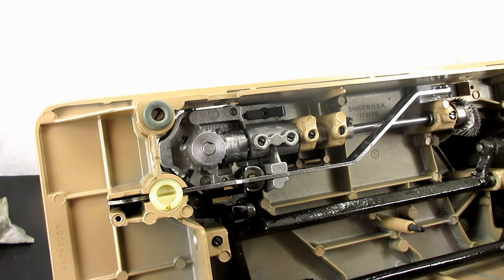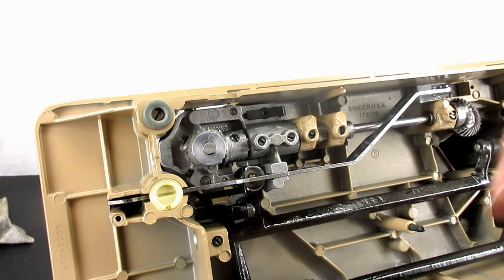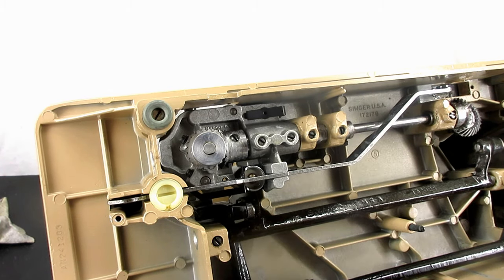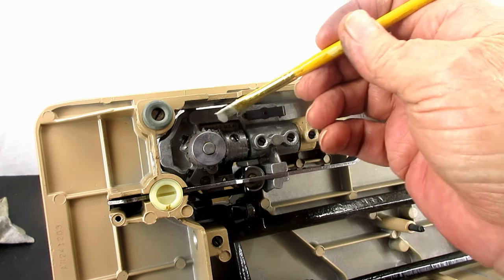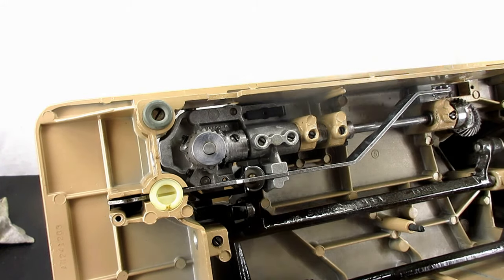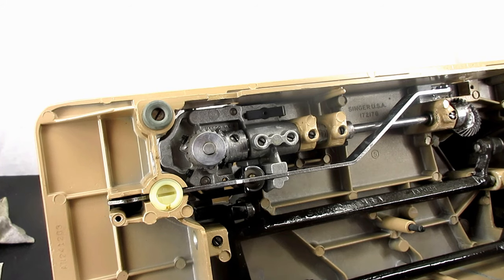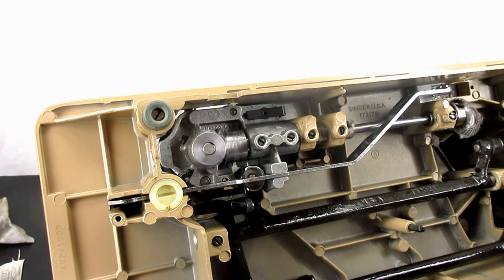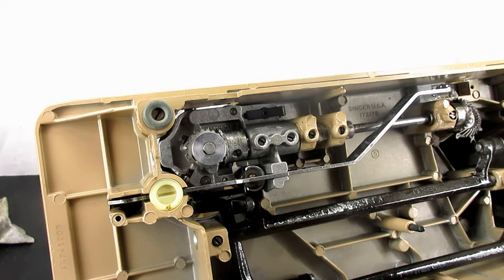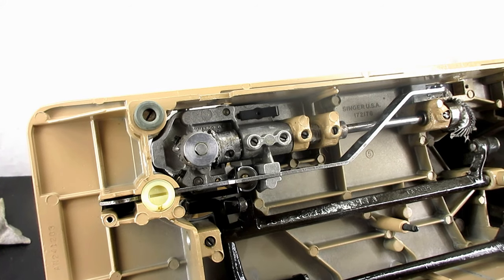But since we degreased everything, in the instruction manuals for a machine like this, you might just see where they show just put a little dollop of grease on one of the gears and that's it. Because as it turns the gear ratio, it will spread that between all the teeth, between the two gears. Okay. So, glad we did that a little bit better.